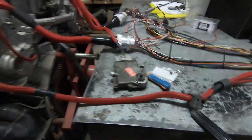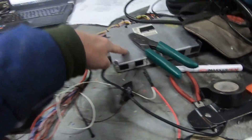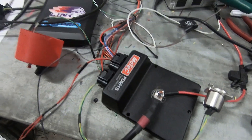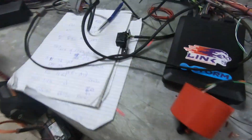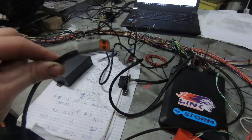For the loom down the front, it needs to go down behind there. It feeds down to the crank sensor, and the oil pressure goes the other way and pops out the back. The airflow meter probably won't be sitting on the bench — it'll probably be attached to the vehicle. Works fine on the bench too. You're going to take the intake manifold off because there's the starter cable to go in. The loom should go down where you want it. Mount the Link, mount the stock computer, mount the PDM, mount the little box, mount the Voodoo box somewhere in there.